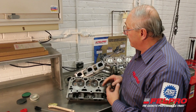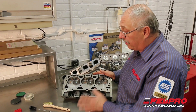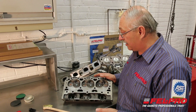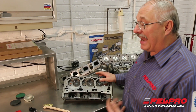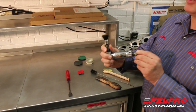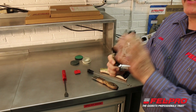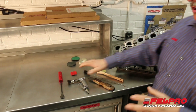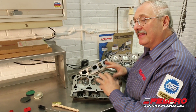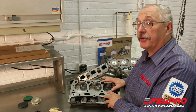The main thing to make sure that you do is these surfaces are clean and dry and you remove all the foreign material that's on these surfaces before you install that gasket. One of my favorite tools is a die grinder with a fine wire wheel in it. The reason I use a fine wire wheel is it won't alter the OE surface finish — it will keep it in the same RA finish that you need, especially on a cylinder head.